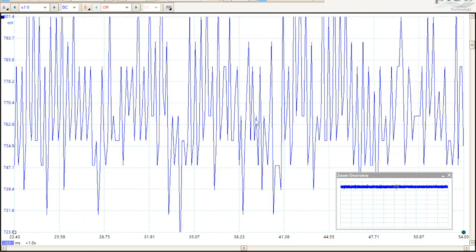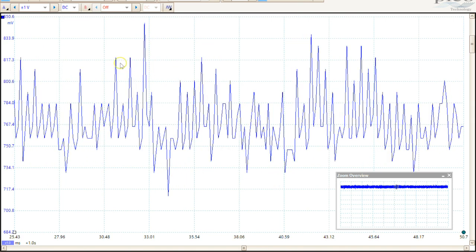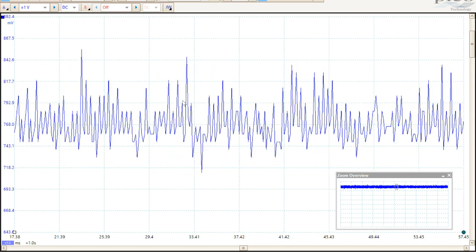We also need to look at the actual line itself. Each of these peaks is, as far as I understand it, amperage flow around one of the windings — or maybe a pair of windings if the brushes make contact with two commutated points at the same time momentarily. We've got the amperage draw going along, and if we zoom out a little bit, it's between 8.5 and 7, so we've got a fluctuating amperage draw of about 1.4 amps fluctuation — and that's on a known good fan, captured at 5,000 samples a second.